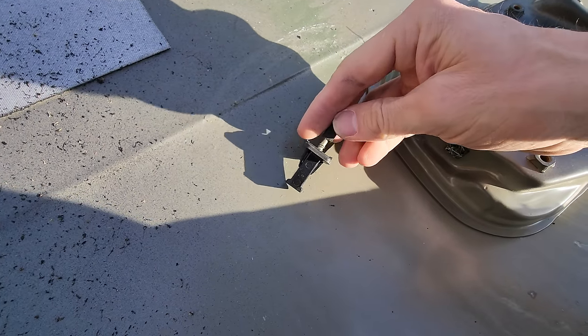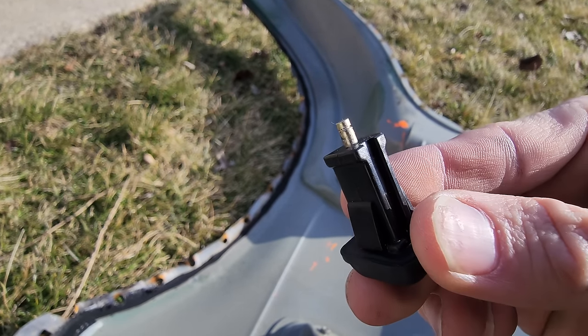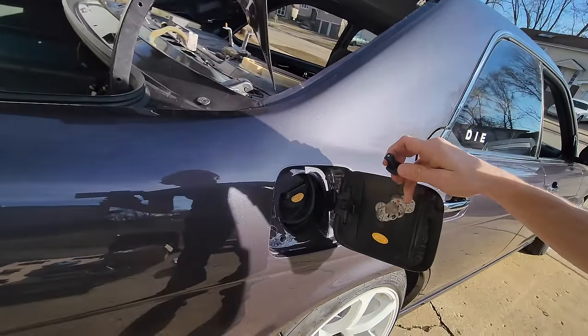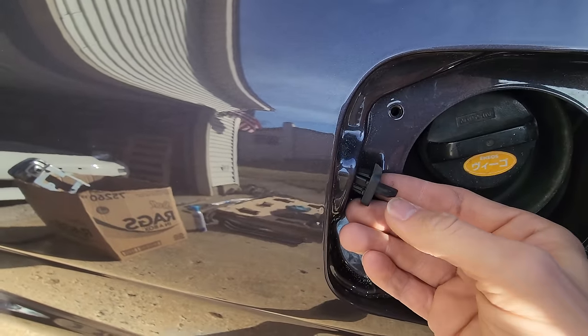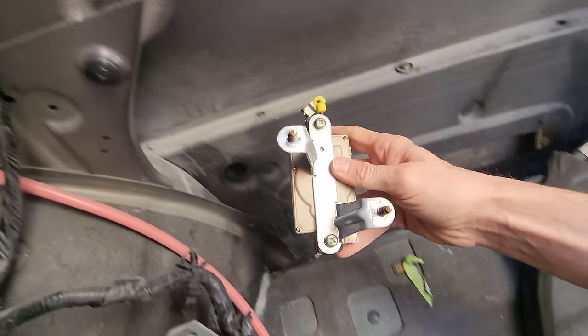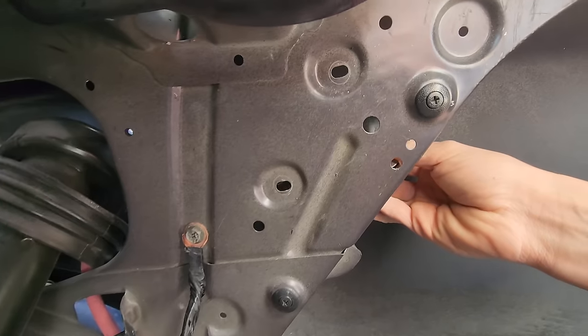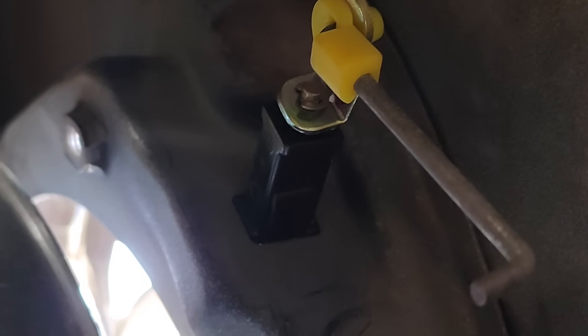This spring actually comes out of here, so we have to be careful not to lose it. When you push in this button you can see the ridge where the C-clip needs to sit — that's going to be a challenge to install on the inside of the quarter panel, especially without losing this little rod. The actuator mounts on the inside, the rod faces toward the fuel door, just gotta find the two studs that line up. I ended up putting the rod on first because there was too much in the way with the whole actuator, and that made it a lot easier to get the tiny C-clip on.